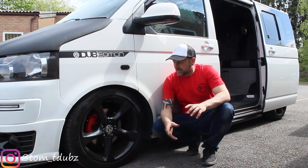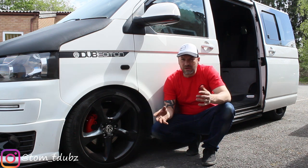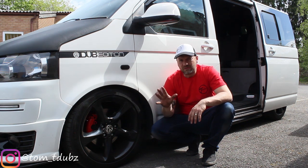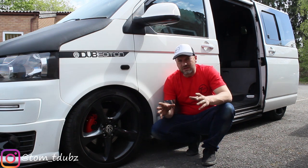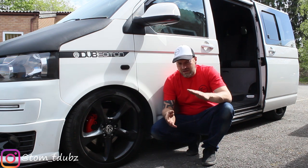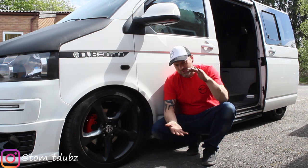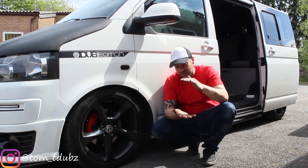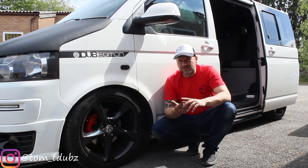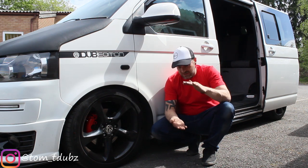The reason why I'm doing the HUB mod is the suspension is quite springy, quite bouncy. The Stance Plus kit on the van rides really well — it's been on there for about five months and it's settled in. The suspension is decent, it rides really well but it is quite bouncy over some of the big bumps. On a wavy road it's like riding a roller coaster. Because the spring is at its longest point it's got more distance to travel, hence the bouncy stuff. Being a low budget kit there's no way to adjust rebound or anything like that, so you're just going to constantly have this bounce.